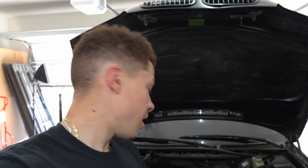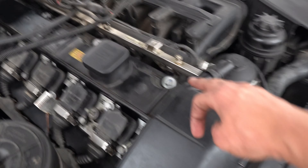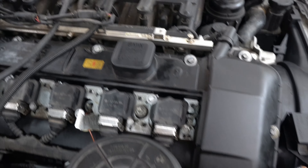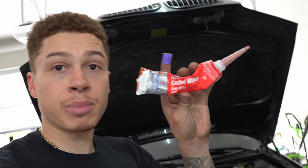The install was kind of tedious. What I thought was going to take an hour and a half, two hours took me almost four or five hours, because of a couple things I missed. When unscrewing the valve cover, I only unscrewed the outer bolts and completely disregarded the middle ones — obviously the cover will not come off if you don't unscrew the middle ones as well. The second thing that took me almost two or three hours was figuring out how to keep the gasket in the valve cover when flipping it without it falling out. The only thing that worked was gasket maker — little dots within the housing. I let it sit for about five to ten minutes, and that held it in place while I flipped it. You still have to be careful, but it gave it just enough stick.